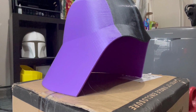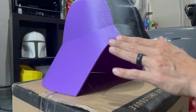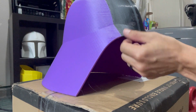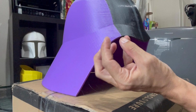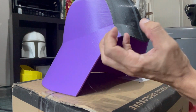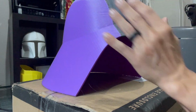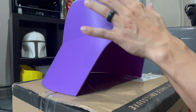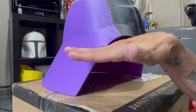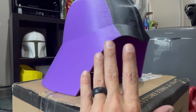If you've ever done any sort of repainting or anything that deals with putting a filler or a paint on top of something, you always want the surface a little bit scuffed, because essentially you're giving the surface little fingers, a little bit of grab. You're opening up the surface, so that when you put on primer or a polyester resin or a filler, instead of the surface being completely smooth, it has these tiny little pores that you've put in. That's why I say fingers.